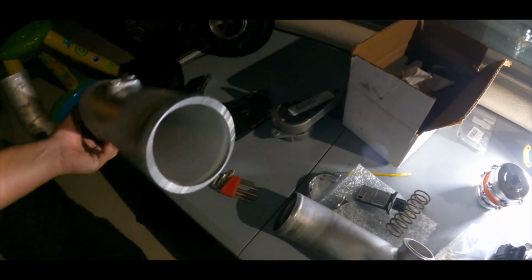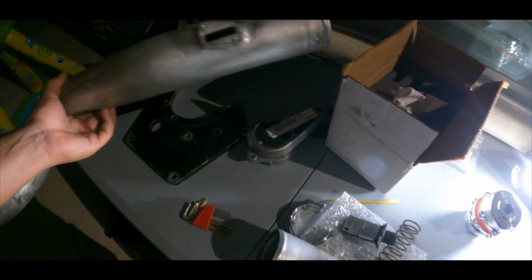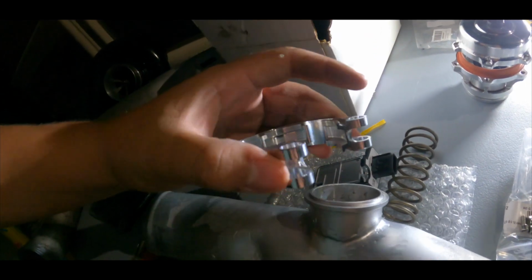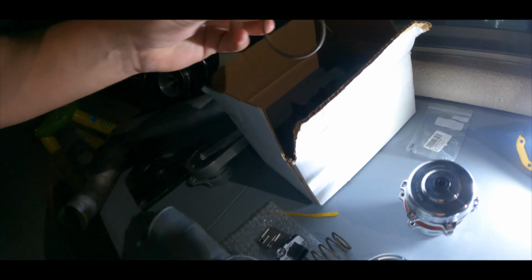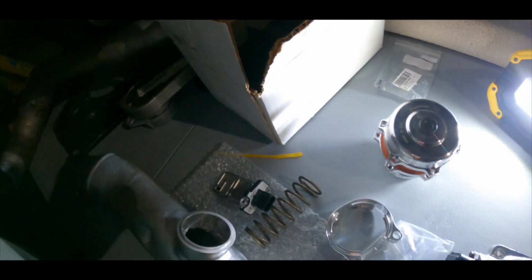So you gotta reroute your MAF sensor. This is a flange also that was welded to it. So you have to relocate your MAF sensor, and then you gotta add this flange for the blow-off valve. The way this goes is you put it right here, boom, and then there's a clamp. This is the clamp that goes with it, and you also have this little thing. It's like a ring. You put it right here over it, so there's no leaks. So we should get that done. That's pretty much the setup on the blow-off valve. Like I said, all the parts will be in the description.